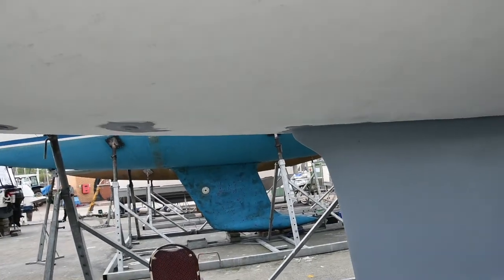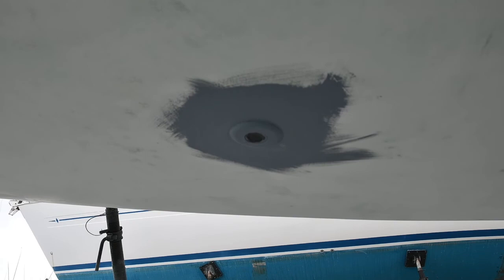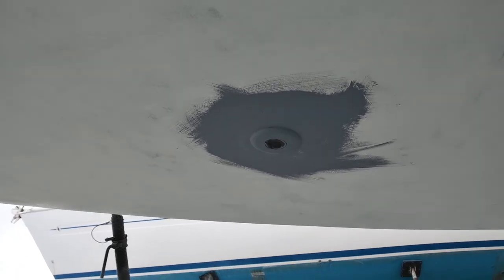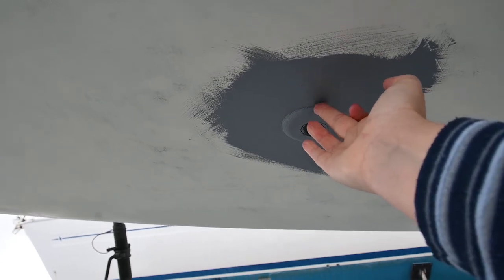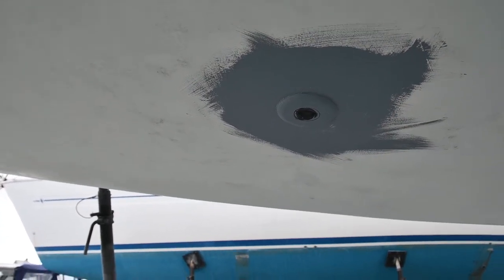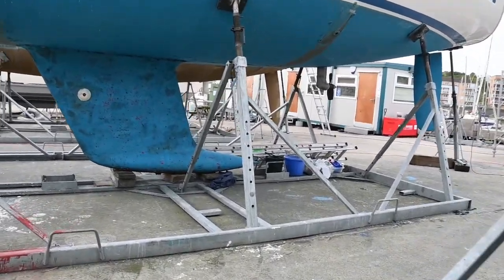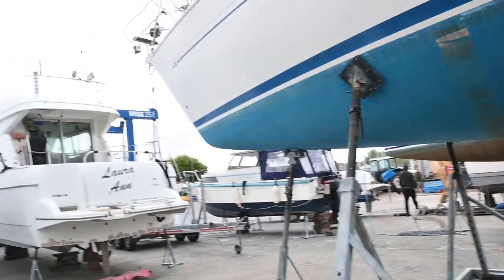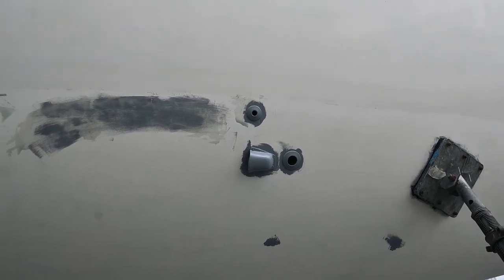I've also used Interprotect, as you can see, on instruments. So having spoken to International Paints, their suggestion was to clean any antifoul off around instruments and Interprotect, so that when we copper coat we can roll straight over the top and that isn't going to cause us a problem. So I've spent quite a lot of time cleaning skin fittings and actually putting some Interprotect on them,